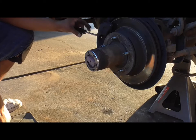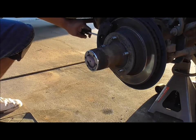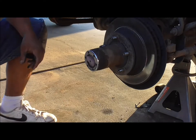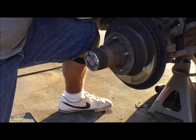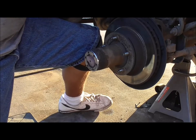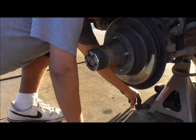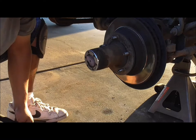Once you pull it out enough you can stick it between the piston on the brake caliper and the rotor itself. Like I said, this rotor is no good so you can push that in a little bit — just a little bit — and then it comes right off. Now what I like to use is an S-hook. Instead of just sticking it up there, I kind of turn it around like this, stick it in there just like that, and then stick it up here on the coil so the caliper is off to the side out of the way. The main thing is the other rotor went bad so we're changing both out.